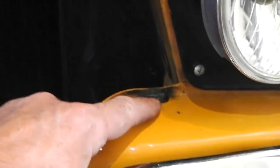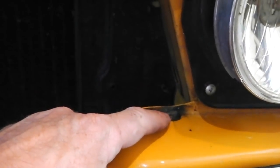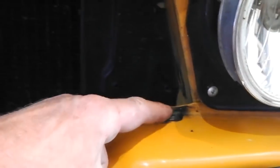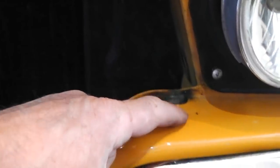Okay, guys and girls, looks like we might be in luck with our fitting. So I'm just offering it up now to the radiator. So grill off, pretty straightforward grill removal. Just watch the tabs on the bottom of your grill, if you're on a GXL grill, or in fact any front grill on a Cortina. You're locating tabs to secure the bottom of the grill so that you don't scrape your upper front valance.